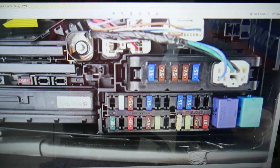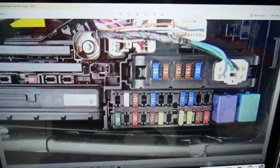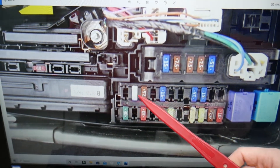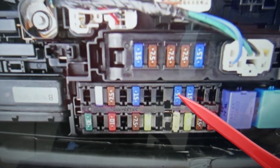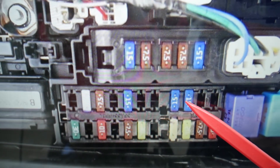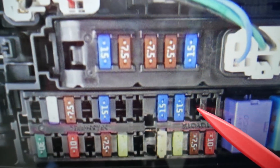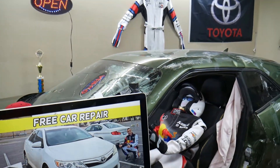Then you'll need to check three more fuses. You may have all of them or you may not, depending on your setup. Come over here and count: 18, 19, 20, 21, 22, 23, 24 — so fuse number 25, fuse number 26, and possibly 27, depending on which kind of headlights you have. Check fuses 25, 26, and 27 here. Hopefully the video is helpful — thank you for watching, see you next time.